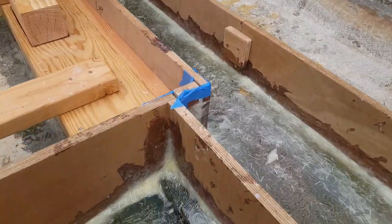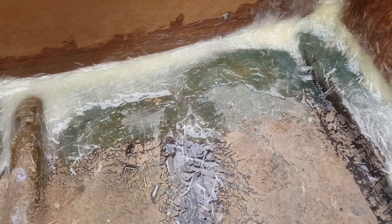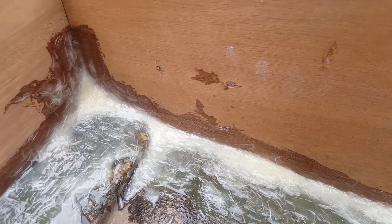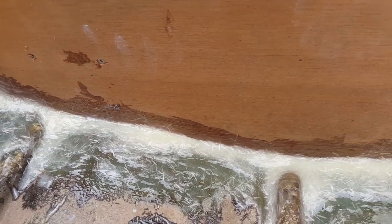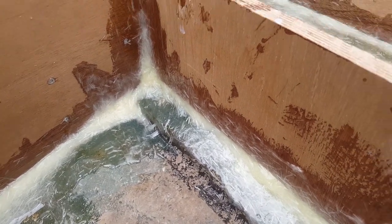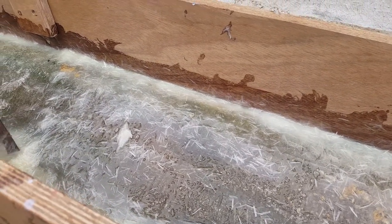Take a look here — you can see pieces of the half-inch chop strand embedded into the epoxy. All the structural joints are epoxy here. This is still somewhat gel, not quite completely set up. The way you can tell is it has a little bit of a yellow hue. When it completely dries out it'll be semi-clear. After the peanut butter dries, we're going to do some light sanding, making sure there are no edges poking up, mainly from the half-inch chop strand.